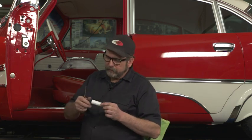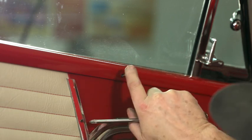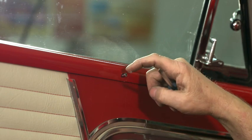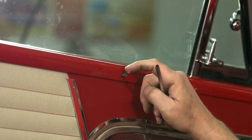In order to get around that, we took some dielectric grease. Dielectric grease is basically a silicone-based grease — it's not petroleum-based. We use dielectric grease because a silicone grease won't stain, it's easy to clean up, and we're going to rub it around the base of the painted surface of our trim and around the base of the screw.